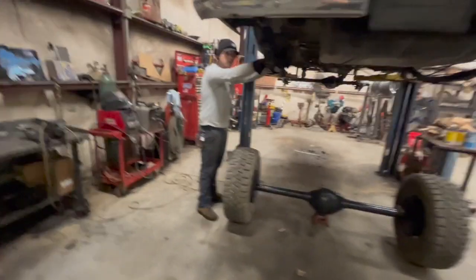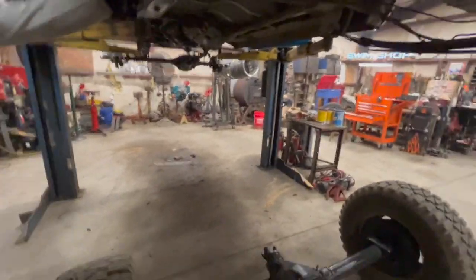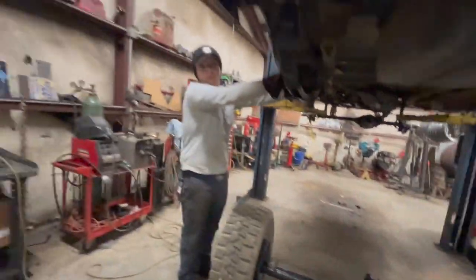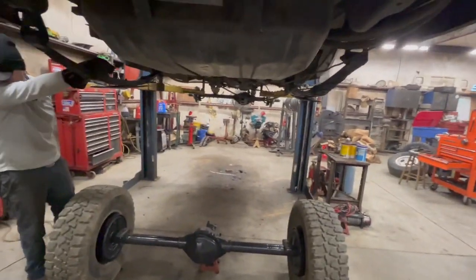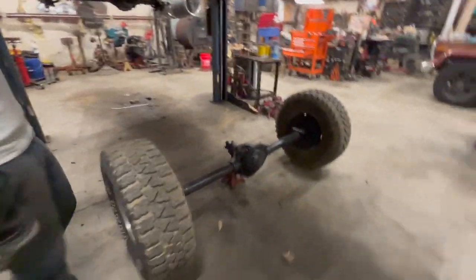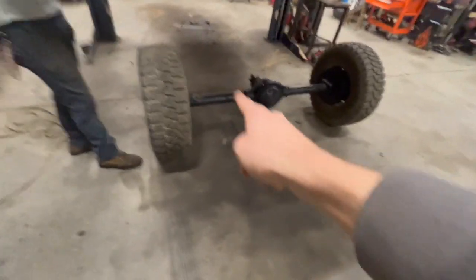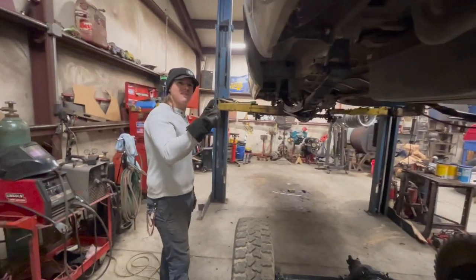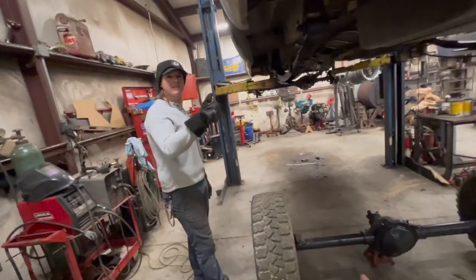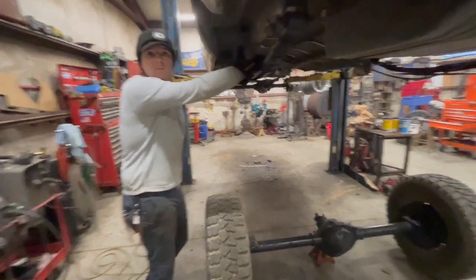But anyway, right now, this is actually all the stock van brake stuff, which in our theory should hook right up to this, or not need much to do so. Exactly. So we got all that over top of the leaf springs, that's out of the way, but another goal is to bolt up all this brake stuff and get this 12 bolt six lug rear end stopping. But I guess we need to grind the paint off of here first and then lower her down, get her set. Tacked and then weld. Correct. All right, here we go.